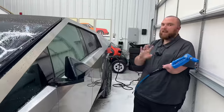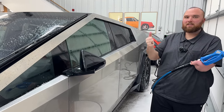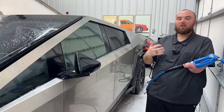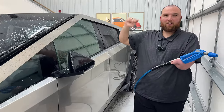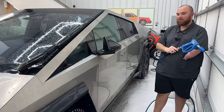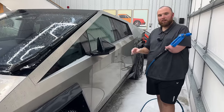It is surface rust, and that's what everybody is freaking out about. But doesn't every car get those? Every single car. You mostly see it on white vehicles — these little orange pimples and freckles all over it. That is from industrial fallout, stuff that comes out of the air and bonds to your paint, and also from brake dust — iron that really gets in there. It also happens during transport. Audis and Porsches that come through the port in Houston get on a rail yard, and this truck was railed up. Not having any protection on here is why finding a coating will really help minimize this.